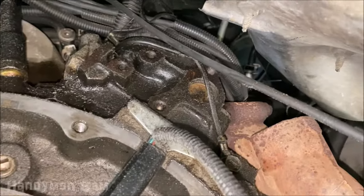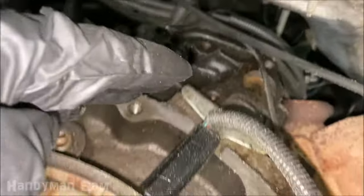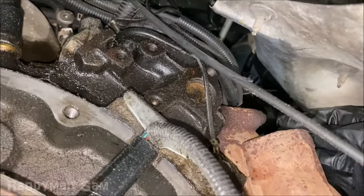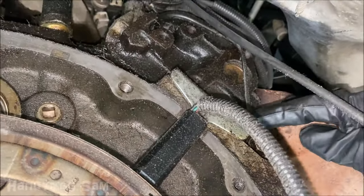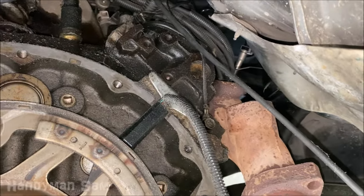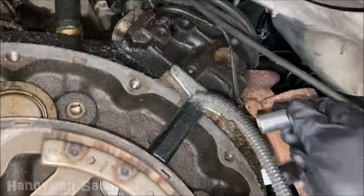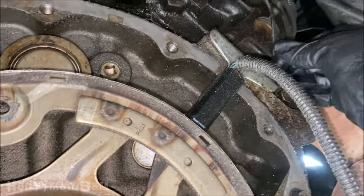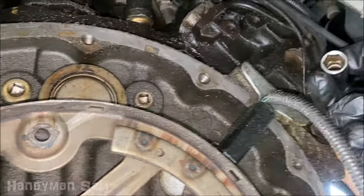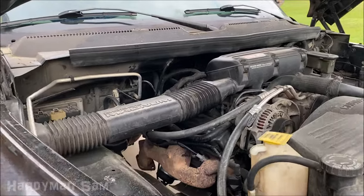You can really come from two different ways — either straight down from the top, or you could try to sneak your wrist around the exhaust when it's cool and slip in a ratchet. I'll show it both with the transmission off like it is now and with the transmission on. You're going to need a half-inch socket, and it's two half-inch bolts. You'll also need an extension to get around there.